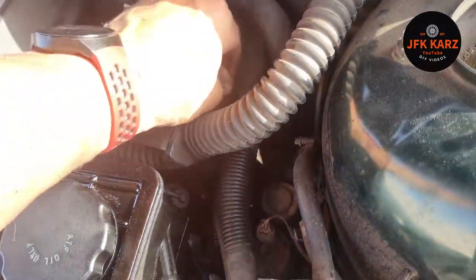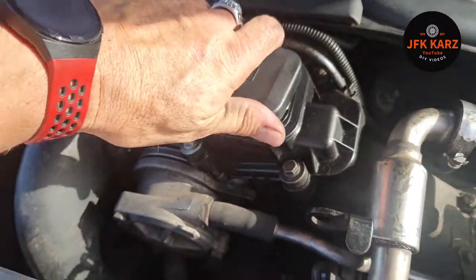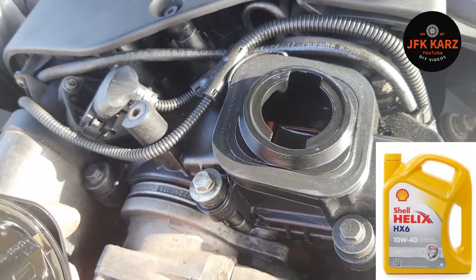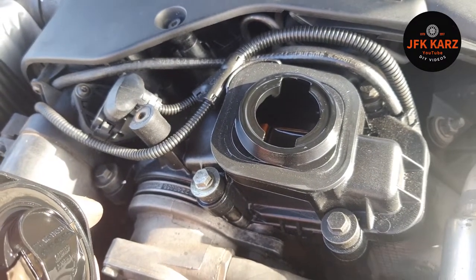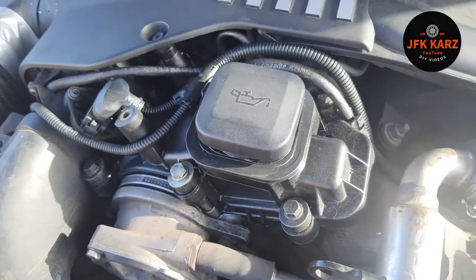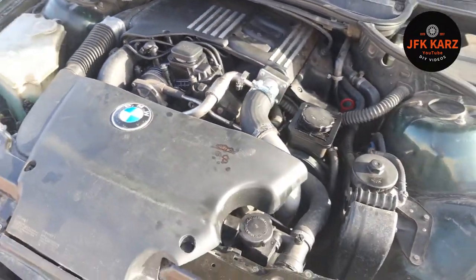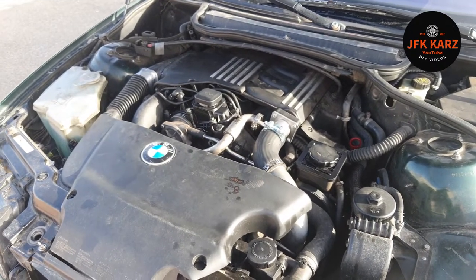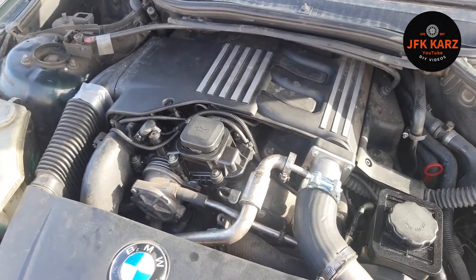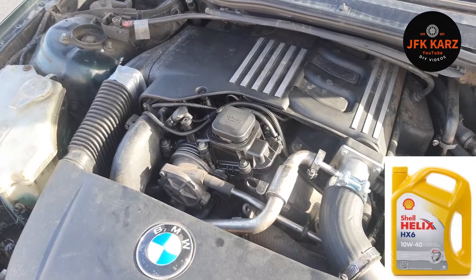If it's not between the range, put some engine oil in. The symbol for the engine oil is that. If it's below, I'd put in at least a couple of litres from a garage just to keep the engine going. You can check when the engine's cool and on level ground to check your level. To get it within the range, you can check the quantity for your car in the owner's handbook. Engine oil is vital. You can check in the manual for which type — I generally use a fully synthetic oil, I think it's a 10W-40.